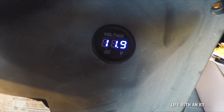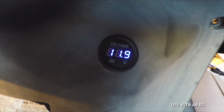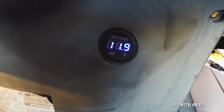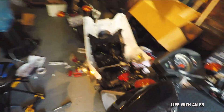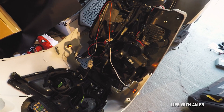It's a bit low because I've been installing lights on my bike and testing without turning on the engine, so it's slowly draining my battery — but it'll go back up. This gives me an idea of the current level of my battery. It's always nice to have, especially on a motorcycle where the battery is so small and you never know the charge. So yeah, that wraps up how to install a voltage meter in your motorcycle or vehicle — let me know if you have any questions, thanks for watching.